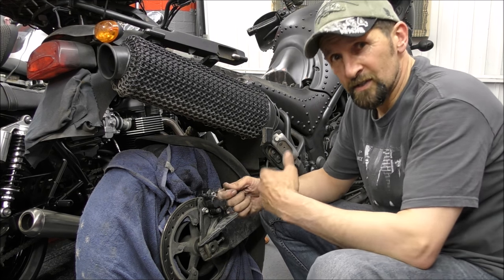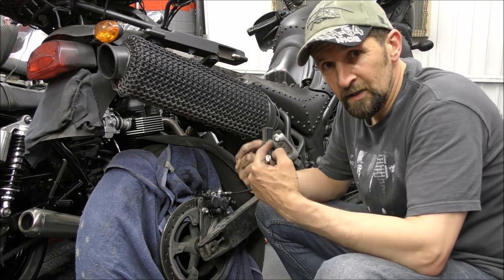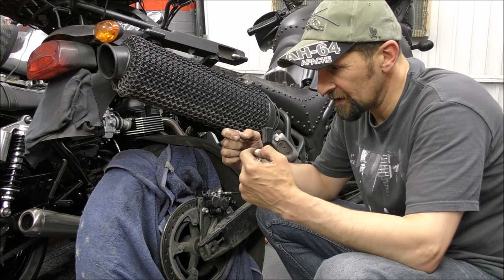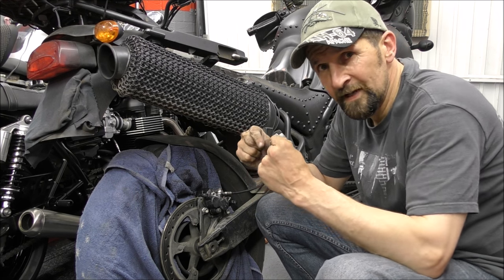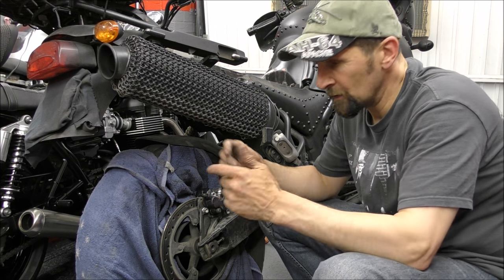It's the toothbrush, it's the bucket of soapy water, it's pumping out the piston, so you see the gum line around the dirt rim, that sort of ring of dirt around the piston. Get that all scrubbed off clean and shiny, and then make sure, usually with either a big pair of grips or a G-clamp, just get those pistons moving in and out so they're nice and smooth. That's just housekeeping, you could do that. It's an old video, I'm gonna bore you with it again.